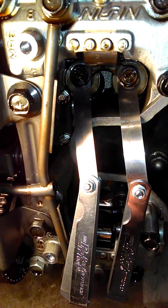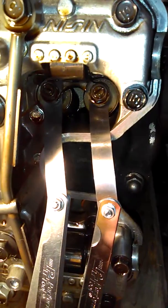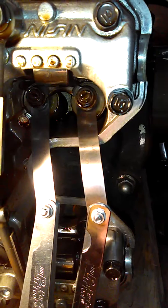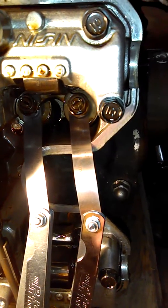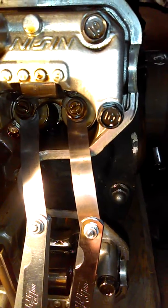Alright, and then it's time to adjust your valves — or check them. In this case I checked them. The spec is 0.005, and you're supposed to use two feeler gauges at the same time, because the rocker shaft is shared by one lobe on the cam and goes over to two valves. This is the intake valve on number two.